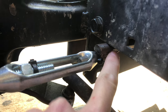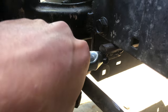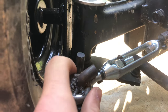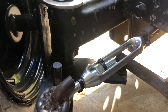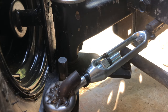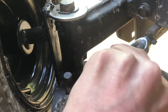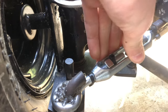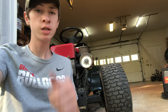I cut the circle end off and welded it on here — this is the right-hand thread. I threaded this onto right here and put a zip tie on there to hold it still, so when I adjust it, it's not gonna unscrew while I'm going down the road. On this end, I put the eyeball over this, welded in place, lined up with that, and screwed it in and put a zip tie on that. I put a left-hand threaded nut right here and put a zip tie on that. So if I screw it this way it'll toe out, and if I unscrew it this way it pushes it out giving more toe in.